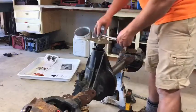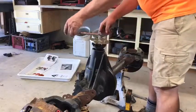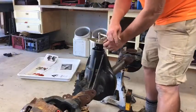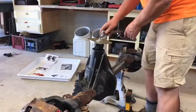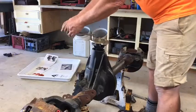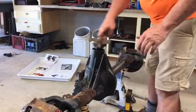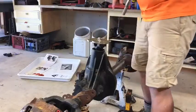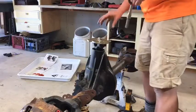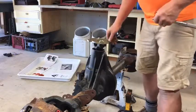I know I'm not over 40 inch-pounds, which is good. As I'm spinning it around, I can also use one of these tools. At 40 it's not above 40 — nice and smooth. And when I adjust it down to 20, it's clicking over that. So I'm not over 40, I am over 20, so I'm in that right range and I'm going to call that good for pinion preload.